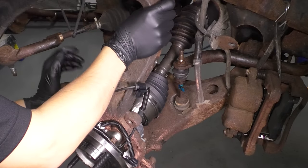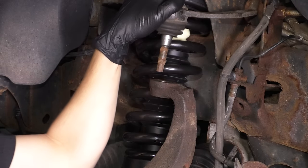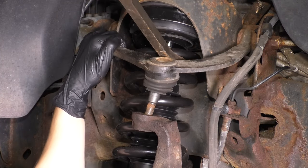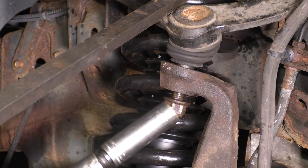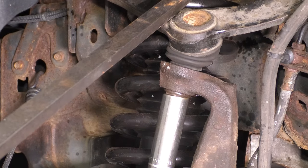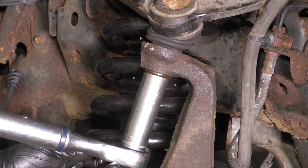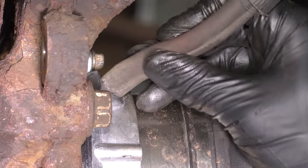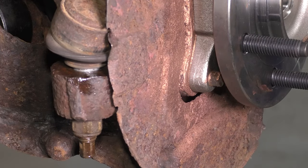Now bring the knuckle up, making sure the axle slides through. As you bring the knuckle up, make sure the upper ball joint on the control arm lines up. You'll likely need a pry bar to pry the control arm down enough. Have the upper ball joint nut ready. Stick the pry bar in between the spring, get it close enough, put the nut on, then use a 21mm socket and snug it up. The torque for this is 85 foot-pounds. Once it's bottomed out you'll be able to torque it. Also plug in the vacuum hose for the hub actuator. Then get the tie rod stud back in, press it down into the knuckle, put the nut on, and torque to 85 foot-pounds.